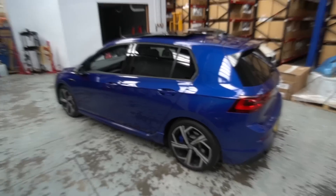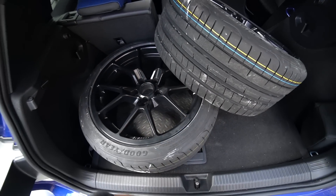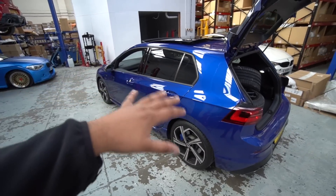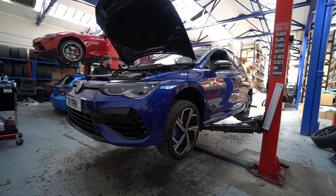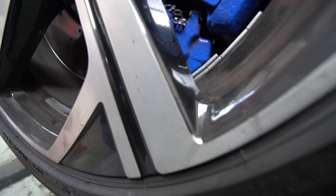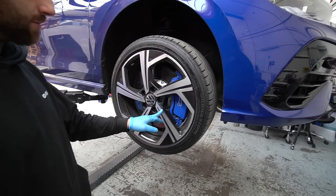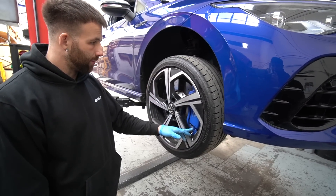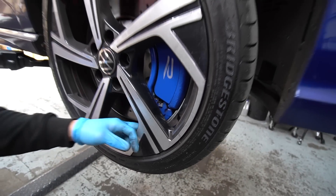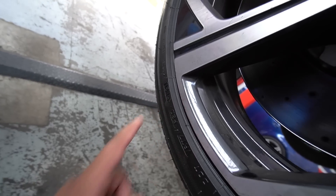These are very familiar — they're the wheels off the RS3, the new Speed R SE10s. They're 18 by 9, ET40. I've got two with me today just to test fit them and basically adjust the ride height accordingly. Aston spotted something — how close that is, it's bound to get knocked off at some point. They should have rotated the tire. When you're balancing the wheel to the tire and there's a lot of weight to add — there's probably a 60 gram strip with another 15 grams, so 75 grams of weight on there.